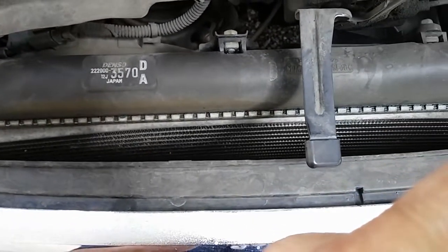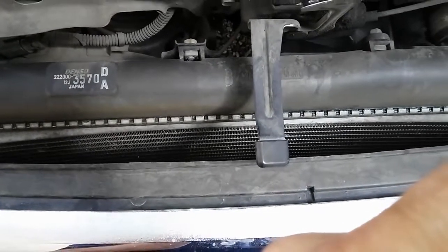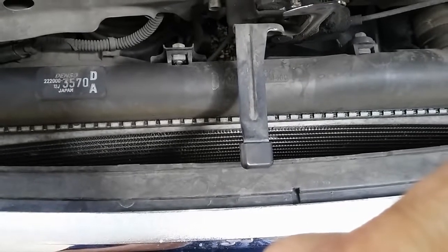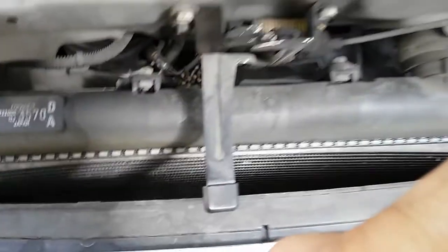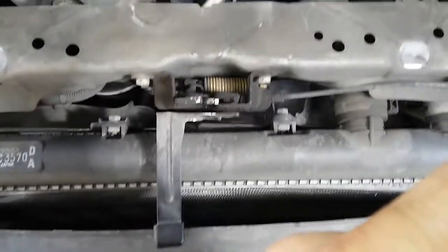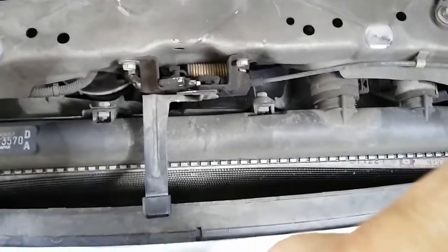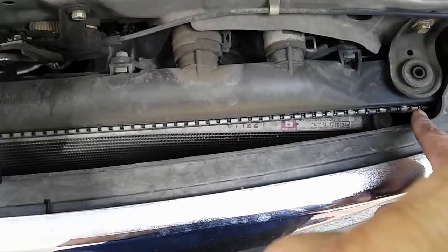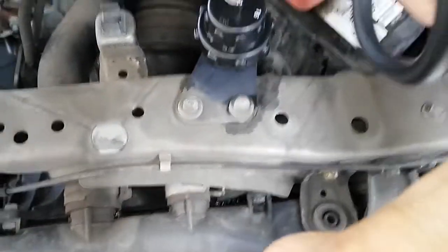So this is how you diagnose a cooling system: apply pressure, wait between 15 and 30 minutes, come back and check your pressure gauge. If you see any type of pressure loss within that 15 to 30 minute span, that basically indicates there is a potential external or internal leak. In this case, the vehicle has an external leak within the upper part of the radiator housing.